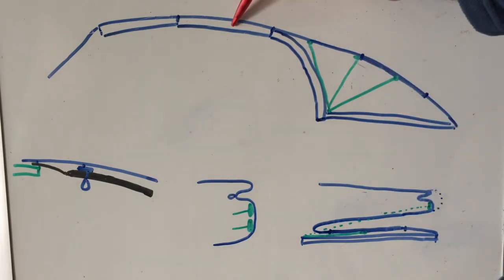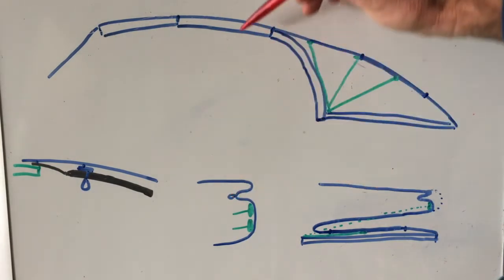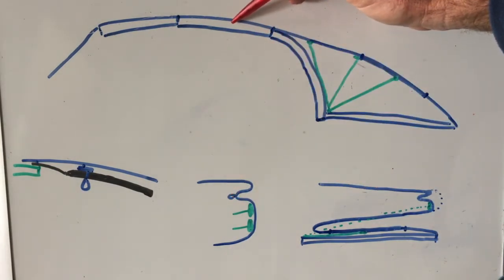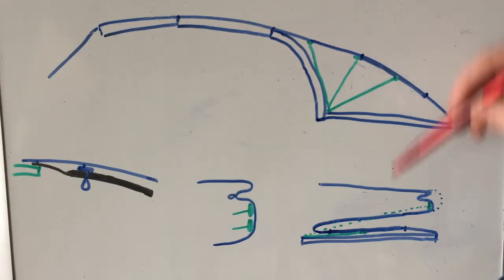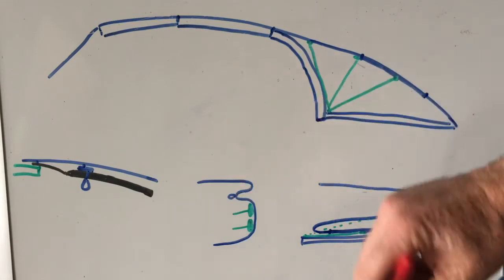It's actually connected up here behind the seals, and when you have sort of half open the roof, you can see all this stuff opens up, and there's a couple of connection points, one on each side for this, they call it a pleat cord. And when it's up like this, everything's nice and loose, but as it actually starts to retract and go into this position, that pleat cord actually pulls on this and pulls it into the right position.